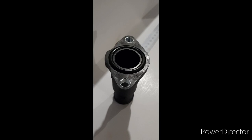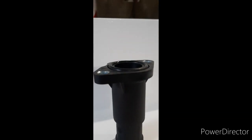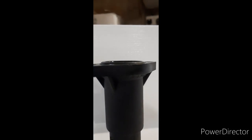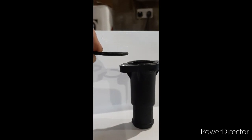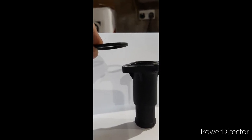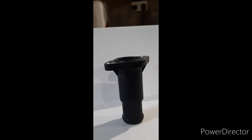As you can see, that's the best seal I've got. There is a tiny gap there, nowhere near as big as the other one, but the important thing is how high that seal sits above the recess - so when you bolt that onto the head, the O-ring is still going to be in contact and seal. Once the flange is tight on the head the O-ring is still doing its job, whereas with that little one, by the time you'd tightened the flange down it wouldn't have had enough pressure to actually seal. So that's one thing I always do - double check the seals.